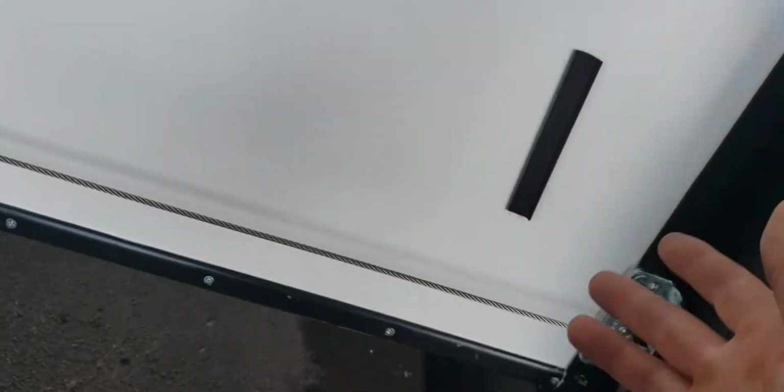It's the same deal with these seals on the sides. Different sides, same concept. Just make sure they're not dry or anything. There's no lubrication that you add to these cables, so don't do anything with that. Keep these on. These are seal flippers. When the slide's coming out, it'll help flip the seal in and out, so when it's rolled out, the seal isn't tucked in. If you ever see that, just pull it out, it'll be fine.